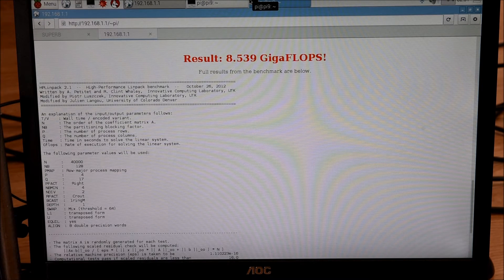I also wanted to know how powerful the computer was. I used two pieces of software to test the performance: OpenMPI, which is Open Source Message Passing Interface, which allows communication between nodes to test performance. I also used HPL, which stands for High Performance Linpack. The performance is measured in gigaflops, and a gigaflop is one billion 64-bit floating point calculations per second.